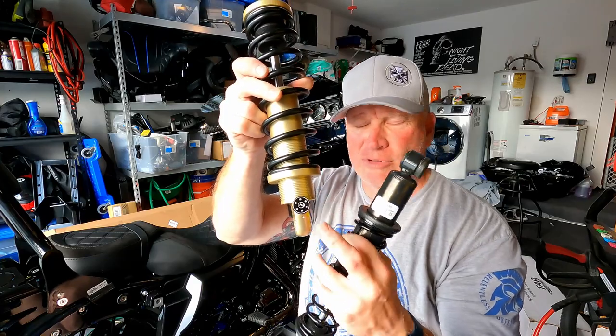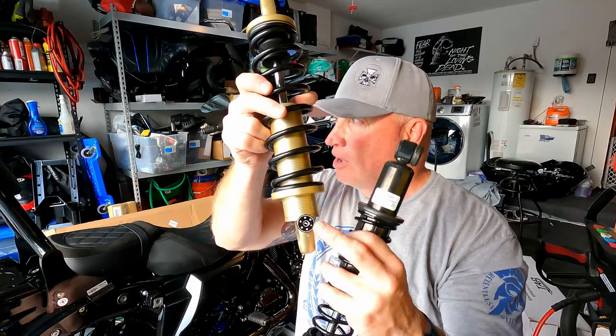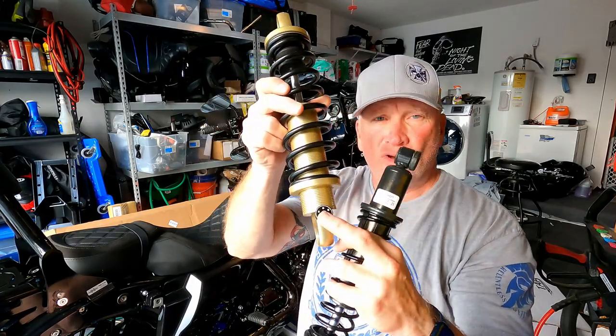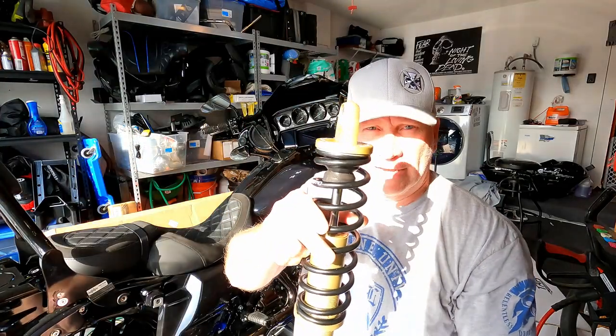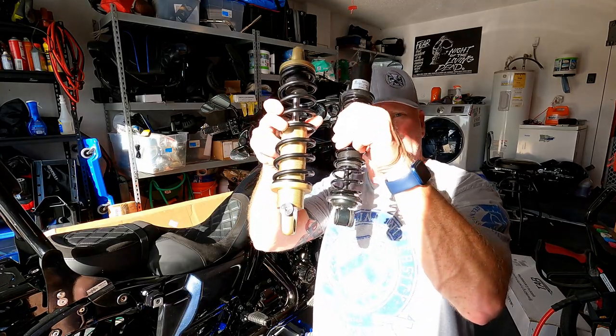I want it at, 1 is soft, 6 is stiff. I want to put it around 2. 3 is pretty much what you got with this, right in the middle. You have no choice. You can do 3 on this and it'll be fine. It's a combination of both. I want to go a little soft. I'm going to try 2. And the sag, I got a set. So that's the difference in the two. We'll do the same thing to the other side.